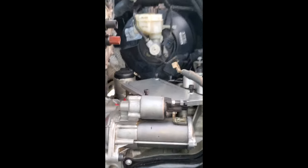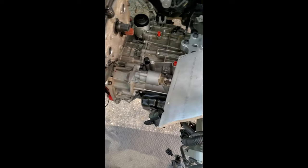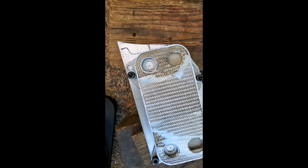I removed the plate, and you can see the plastic plugs I put in — I don't want any debris or dirt to get inside. Any time I take the plate off for test fitting, I plug the holes right back up. You can see where the O-ring laid a groove from the weight of the plate resting against it. Once we drill the holes properly, we know this is going to seat down and definitely have good O-ring contact. I'm using an old-school punch tool to make sure all my holes are perfectly centered — and as you can see, that's directly in the middle.